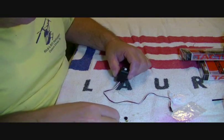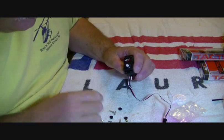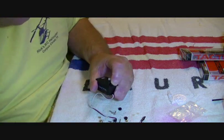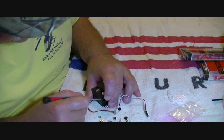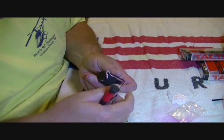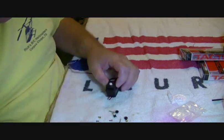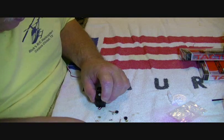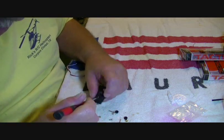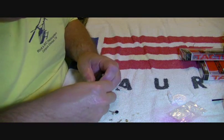What we want to do first — this particular servo has just round holes with round grommets, so I'm going to need a little flat head screwdriver. You'll just have to kind of fold these and get one corner kind of started, then take a screwdriver and just push the rest of it down through there. I may have to go all the way around it. There we go — that's pretty easy. Just make sure it all comes out on the bottom and unfolds under there so it's nice and snug. Let's get all four of those put in here.